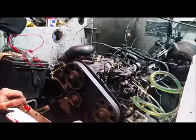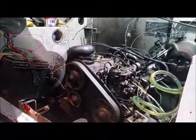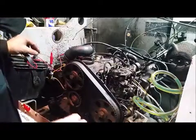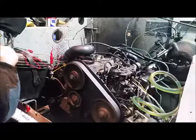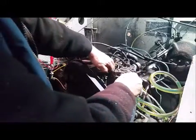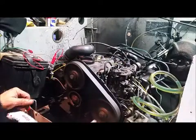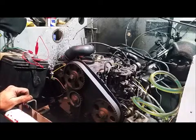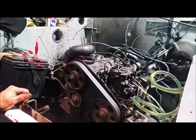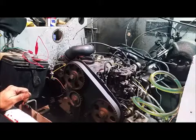We've got the injector pump put back together after unsticking it. We've got the fuel solenoid turned on, we've got a little bit of glow plug, and we'll start. Well, that's really better. It's not quite as active as I would think, but that seems to be significantly better than the high idle runaway we had. The throttle doesn't seem to ramp all the way up, but maybe I need to adjust it — that's good news.